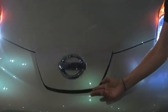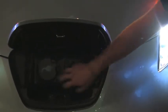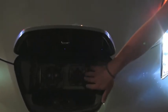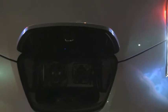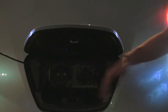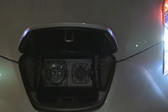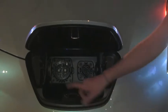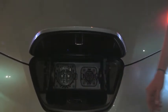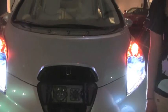There's actually a button inside the car that pops this charge port open. You have two actual plug inputs here. The one on the right is for home charging mainly, and also for Level 2 charging stations around the city, which are 220 volt charging stations — that gets the job done in four to eight hours. This other one here is your quick charger, which you'll see more along freeways or maybe in a Costco with industrial strength equipment. That is a 27-minute charge to 80%. Three-phase DC — I think it's a 440 volt, 50 amp.